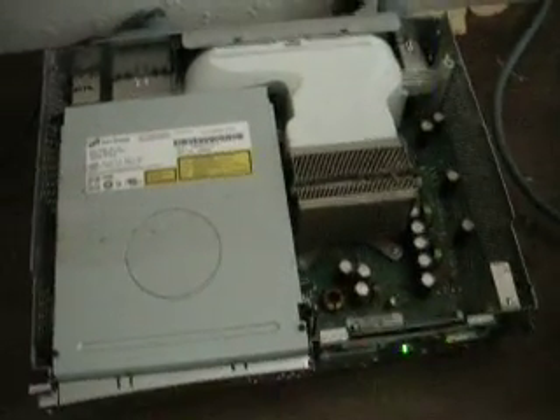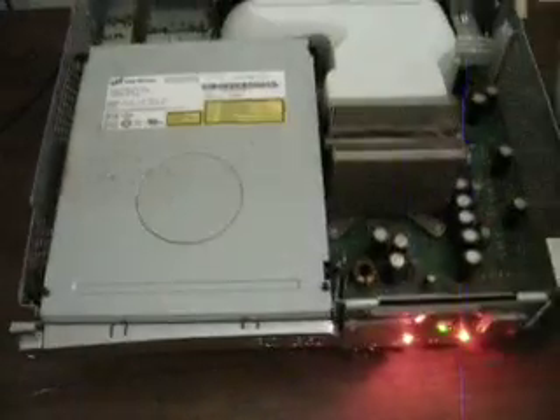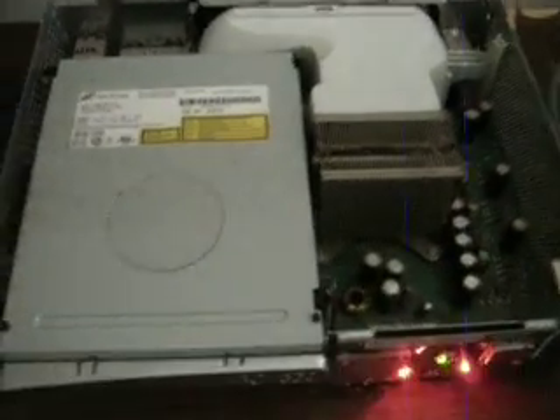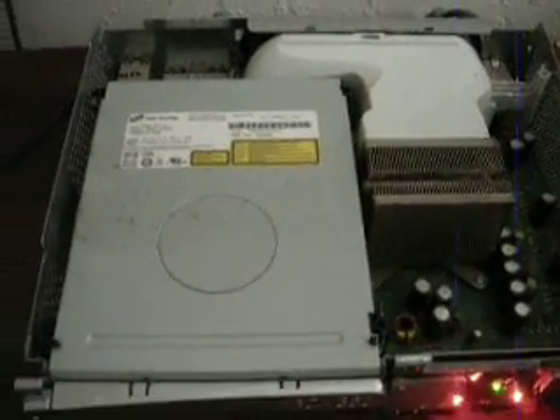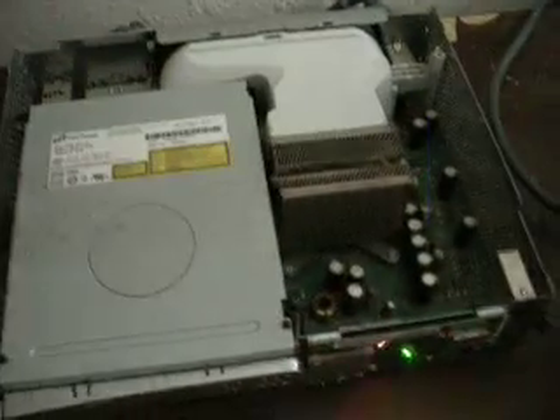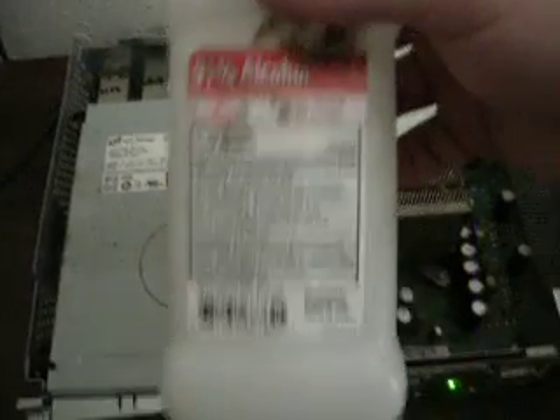What I'm going to do now is carefully remove the X-clamps, and then I will clean all the old heat sink compound — basically the tar that Microsoft uses. I'll dip some Q-tips in Goo Gone, and then remove the Goo Gone with rubbing alcohol, isopropyl. And then I will do the reflow and show you that process.